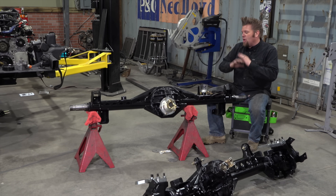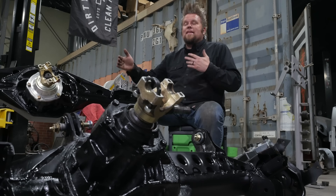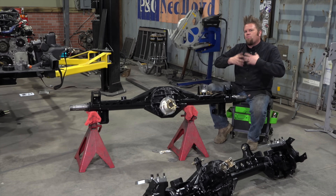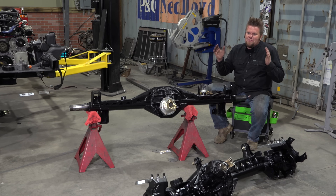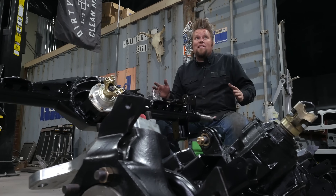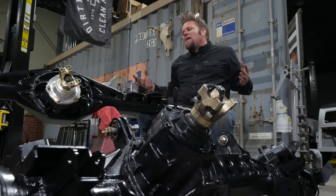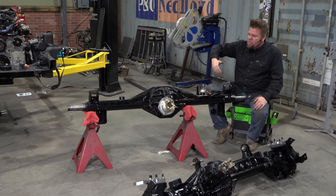I really do think that these fabricated nine-inch axle assemblies are possibly my favorite axle to build, for a bunch of reasons. Number one, they're crazy light and super strong — and they look really cool. I mean, this looks like a whole bunch of race car axle going underneath this classic '53 wagon. But at the same time, I think it's more just the process of putting them together that I really enjoy. It kind of lets me take care of two things: I basically get to do a whole bunch of fabrication — welding on the trusses, setting the width, making sure they're straight — and then I get to flip a switch and do a whole bunch of mechanic work setting up the third members, installing the gears and the lockers.